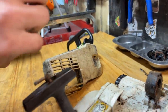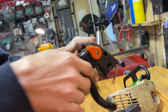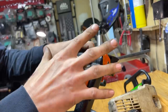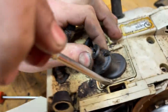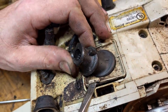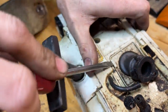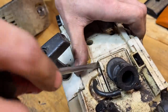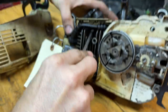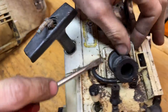Then you're going to have this wire here that pulls right off. A lot of people have a really hard time taking these handles off — they rip this wire out or take the side off. You don't need to do that. If your high idle works, which it does on this one — and that will go out a lot — if it's in good condition, do not take anything apart, just leave it. This clamp that goes on the intake manifold: there's no good way to say it, you have to put a little bit of pressure on it and work it out, but work the edges out slowly.